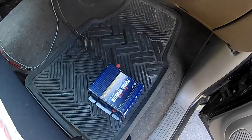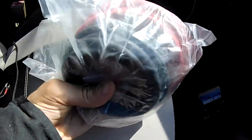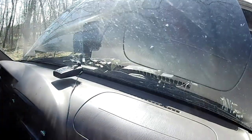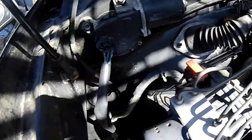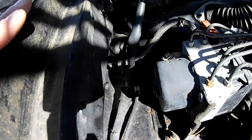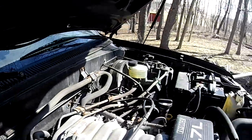I didn't have the cable so I ordered some. These come with the lugs — about 10 feet — should reach from under the dash all the way into the engine compartment. I'll have to find a way to run it through the firewall. It looks like the best spot is right down here in the corner, and then wire it all the way around to the battery.